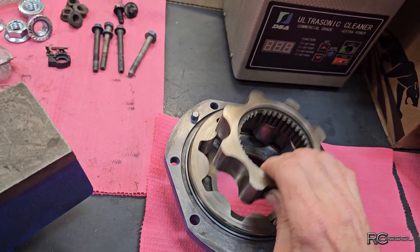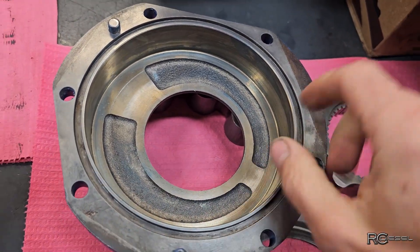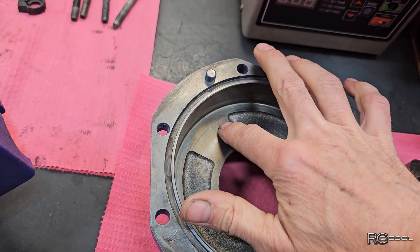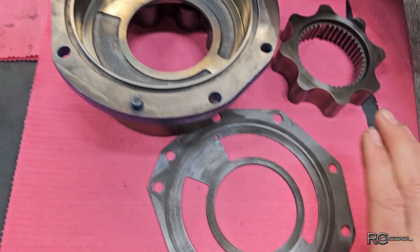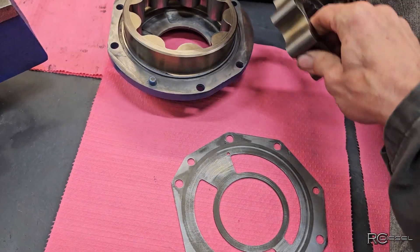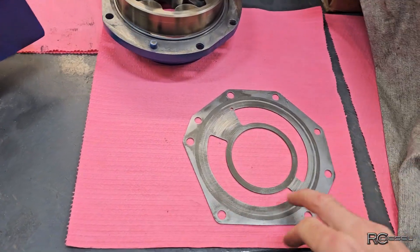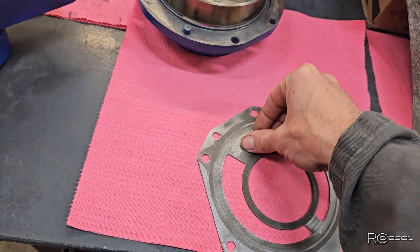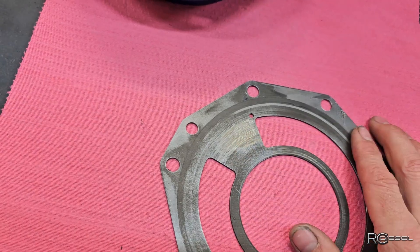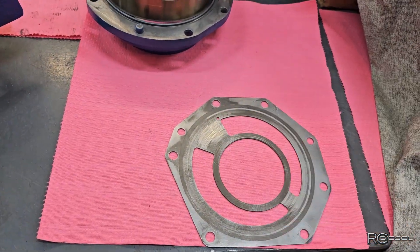Let me get these gears out of here. The housing itself is basically perfect - there's no real grooves in it, just one tiny little line you can barely feel with your fingernail. So why did the wear plate side wear so much? I have a theory. I don't know if I have pictures of this oil pump when I was taking it apart, but this thing was completely siliconed in place. A lot of that silicone got to the inside, and that hole right there was plugged with silicone - I believe that is the lube hole that lubes this part of the pump, and that's why it ate this out here.